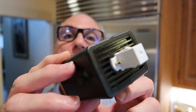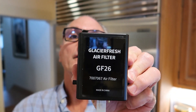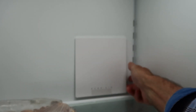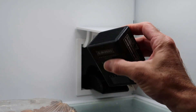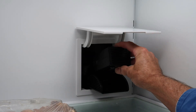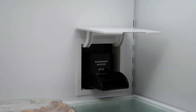SubZero's engineering department gets a gold star. This is the new air filter relay assembly — it's Murphy-proof. You can stick it in the hole this way, or this way — it doesn't matter, they were thinking. We're going to open up the Pure Air door, pull to eject the old one. It rattles, just like the new one — must be the charcoal inside. We'll take the new one and stick it down in there.